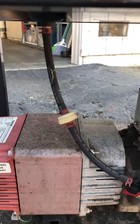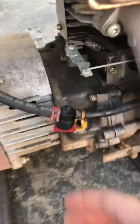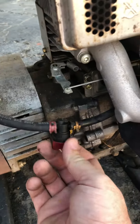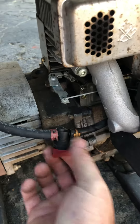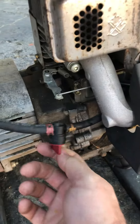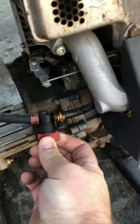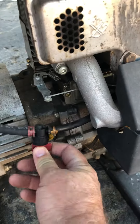You've got your line that comes out of the bottom and the filter — the inline filter. This is your petcock that turns the fuel on. Want to make sure it's running in the same direction that the line is running. If it's in this direction, it's in the off position — you can see where it says off on there. We want to put it in the on position.